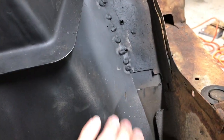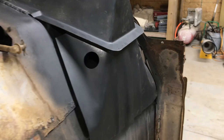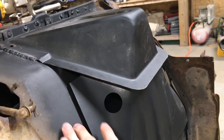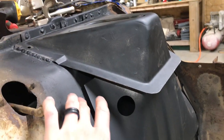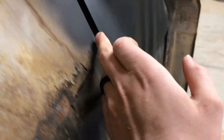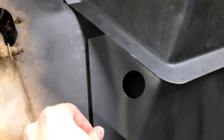I'm getting a little better with my welding - just trying to make it as strong as I can, and it ain't going nowhere. There is a little bit of a gap here. I'm gonna have to get my rubber mallet and kind of push this down a little more. The factory one was touching, but I just could not get this down with this notch to touch the bottom of the cab. This is a factory notch on the old cab mount too, but it's kind of bent down on the factory mount, so this is gonna have to be pushed in to touch and I'll have to put a couple pinch welds in.